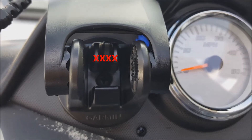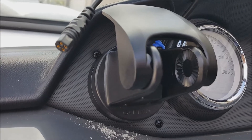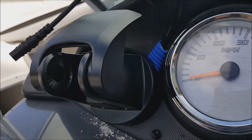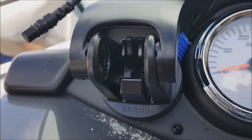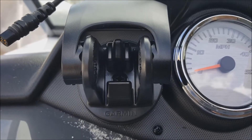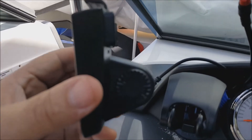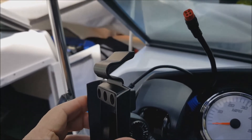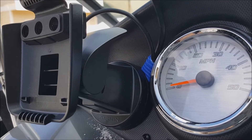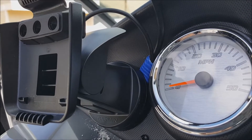That center hole has a screw that mounts the lever — it snaps on. The power cable is red and the transducer cable is black. The X's mark the area where you run the threaded screw back through and tighten it down. That's the finished product. The lever allows the first-time installation of the quick disconnect. The head unit disconnects from the quick disconnect — so you lift the lever, slide the unit in, close the lever down, and bring the wires up through those three holes, using the left and right holes.